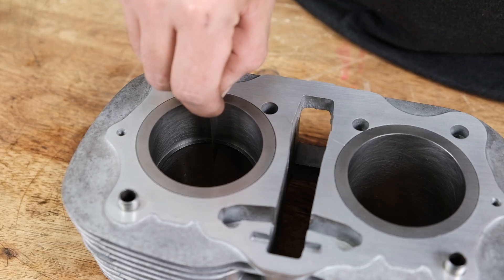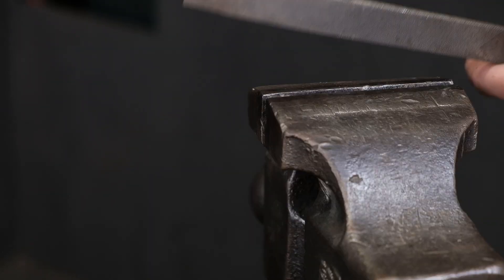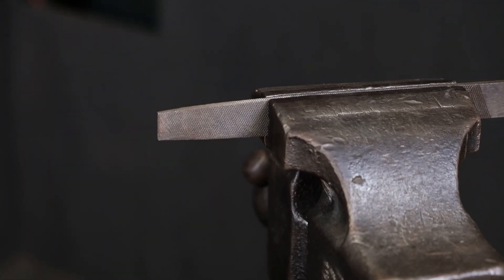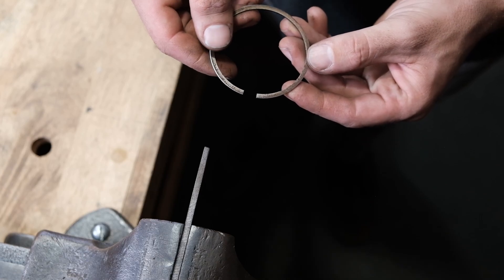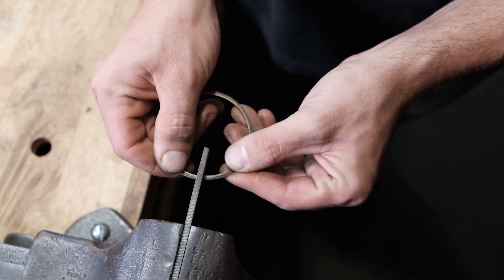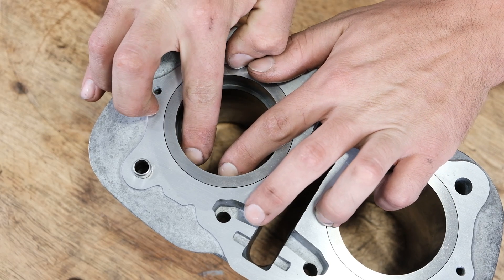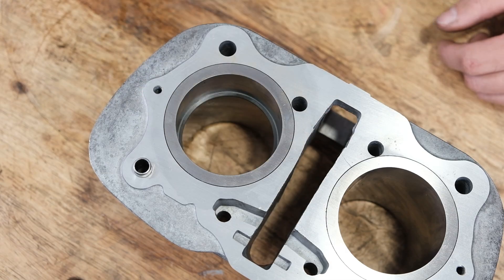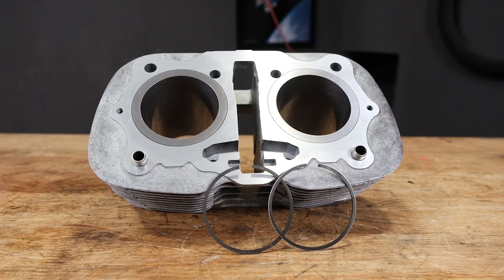If you find that your piston ring gap is too small, it needs to be filed to fall within the standard value. Machine shops have dedicated tools for filing piston ring gaps, but you can actually do this easily at home with a vise and a flat file. Clamp the file into the vise so that it's pointing straight at you. Lightly press both sides of the piston ring against it as you push it across the file — this will keep the edges parallel and remove material evenly. Make only one or two strokes before rechecking the gap in the cylinder. Usually a few strokes is all you need to get most piston rings into the correct value. Once everything's in the correct value, you're ready to install them.